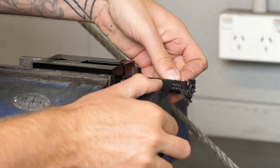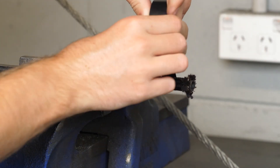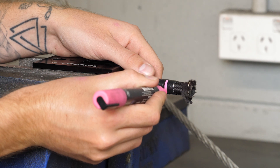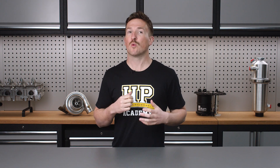The first step is cutting the end of the hose, assuming we already know our desired hose length. We can mark our cut point with a marker or paint pen, and it can be helpful to use tape here as well — race tape or electrical tape works well. There are also products like Vibrant Performance Clean Cut Film and Tape, where a layer of self-adhesive film is wrapped around the hose first, followed by adhesive tape, so it won't pull the end of the braid apart when removed and leave any residue.